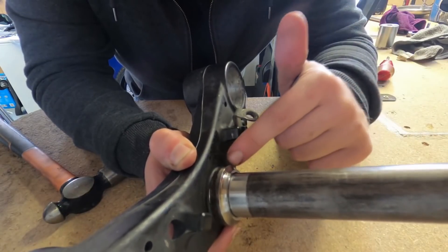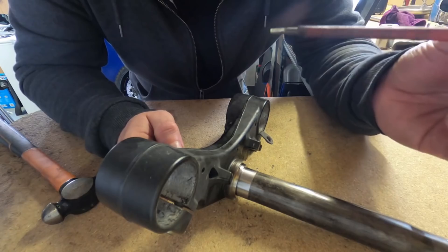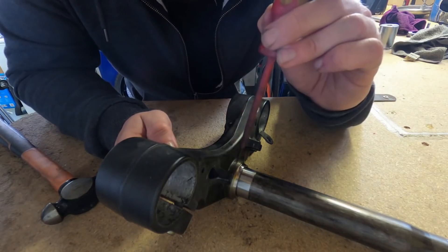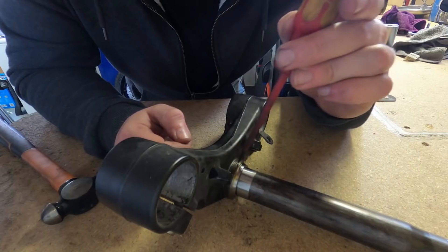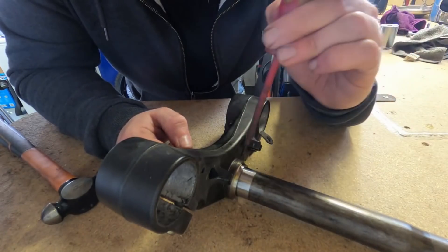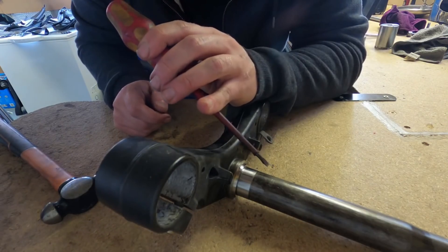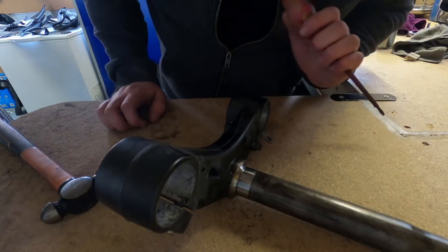The guy who sent me this video said I'd recognize the moves in it. Sam's taking apart his steering head bearings. Some people have a different type of bearing which is easier to get off. He gets a screwdriver — just an old one, nothing decent — hits it down between the bearing race and the yoke to drive a gap. Then he works in a thicker screwdriver, then a chisel to do the same thing.